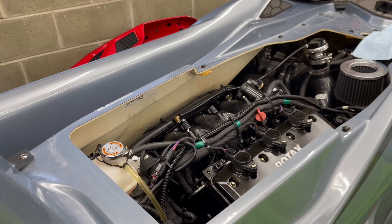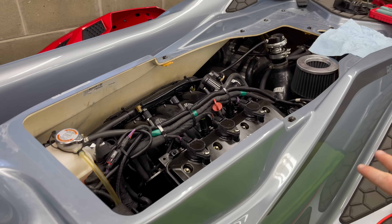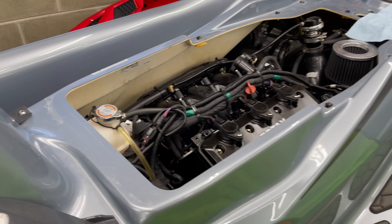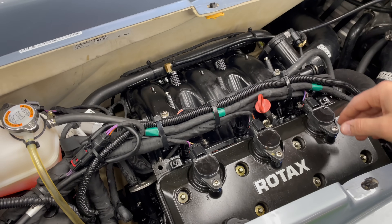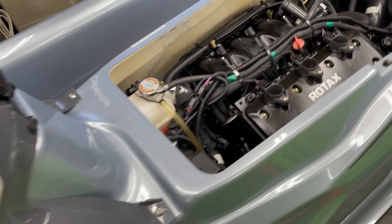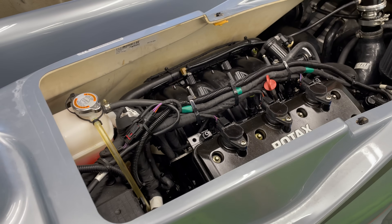That's all we need to do for the fuel injector flow test. Everything's finished here. If you do this for yourself, you want to make sure that you don't button everything back up until the fuel that's spilled — it's unavoidable, there's always going to be fuel in the fuel rail — has time to vent off and clear. So if you do this yourself, I would keep off your cover and your seats and just give it some time to ventilate.